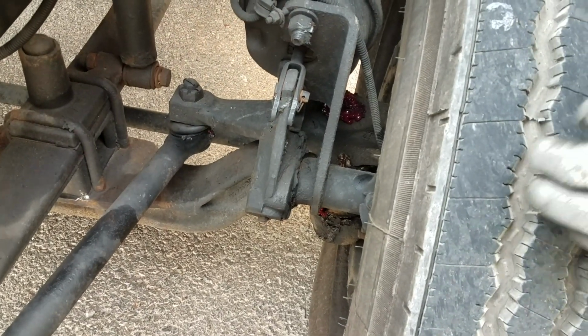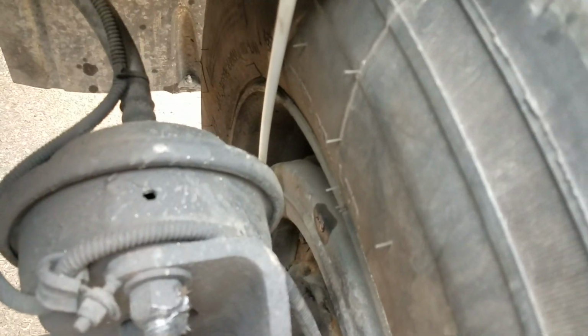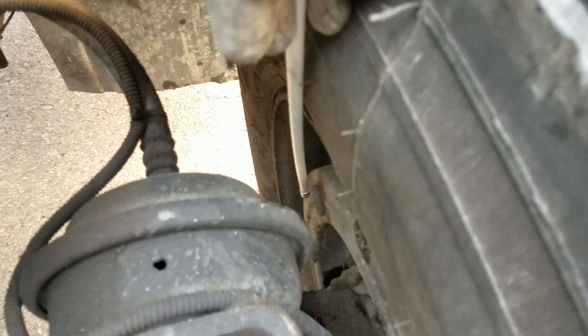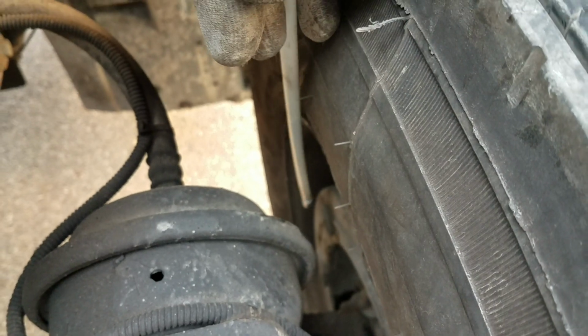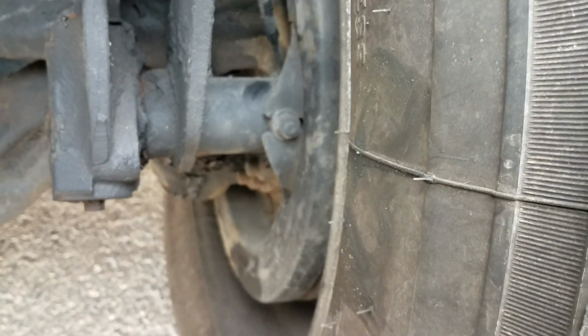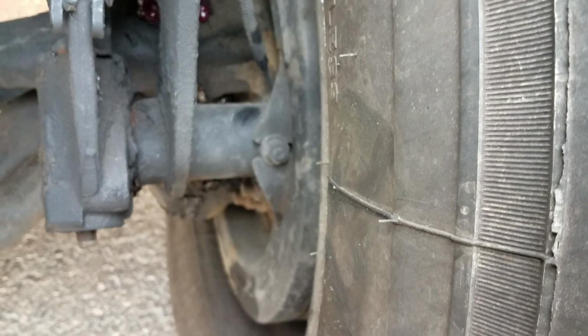From there I'm going to go ahead and check inside the back of my tire. I do have my brake drum, also known as my rotor, in good conditions, not cracked or broken, free from any illegal welds, and it shouldn't have less than 1/2 material. Now for my brake lining, also known as my brake shoe or brake pads, they should not have less than 1/4 raw material, free from any oils, as that can create a fire or brake failure for both of them.